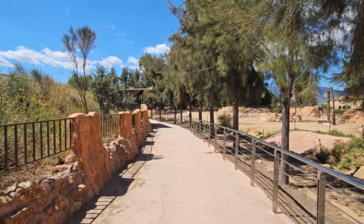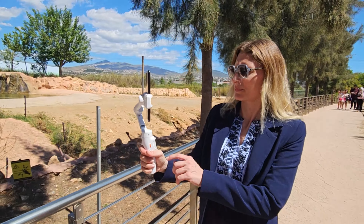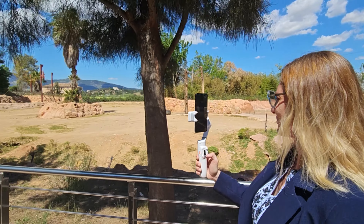Note that the default factory setting is to mount in vertical, and when switched to landscape the AI tracker faces down. You can change this in the Hoheim Joy app: go to camera, then settings in the top left corner, then gimbal parameter settings. There you can switch between landscape and portrait orientation, and toggle the AI tracker between facing up or facing down.